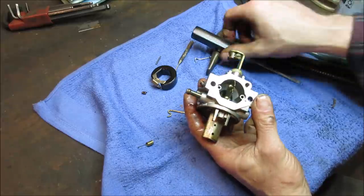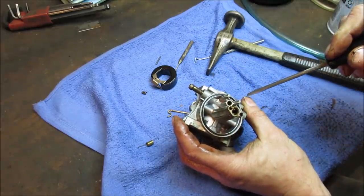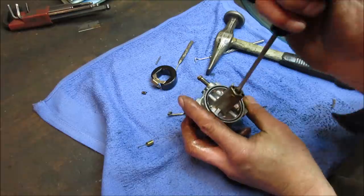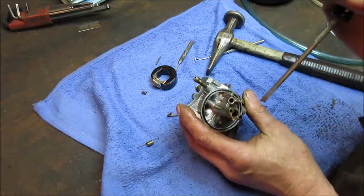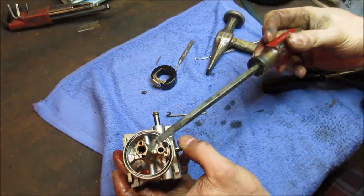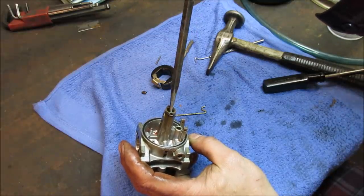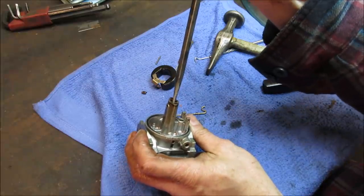And you know, if I don't clean it, we'll have issues. I don't know if we can get the whole emulsion tube out of it. Let's see if we can feel like we lock on to anything. Yeah. It's like a whole nother level that can come out. I'm gonna get a fatter screwdriver that fits that a little bit better. Does it look like I've used that one before? Ground the sides down so we get down in there. Yeah, brass and aluminum generally isn't too bad, but when you introduce gas, then the gas goes bad.